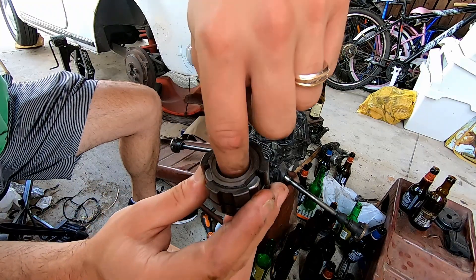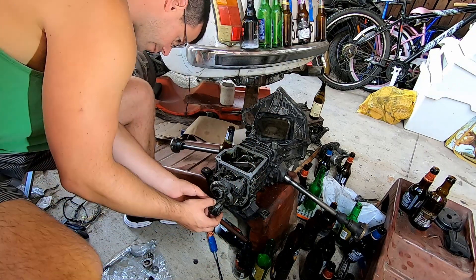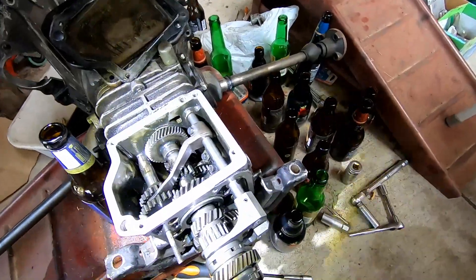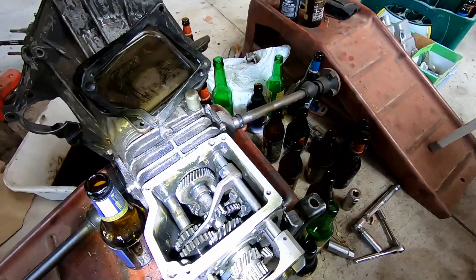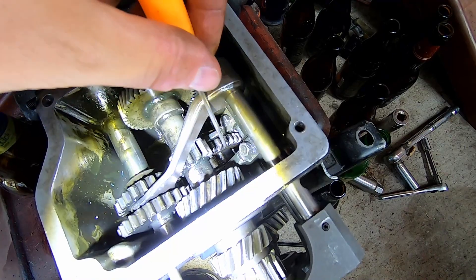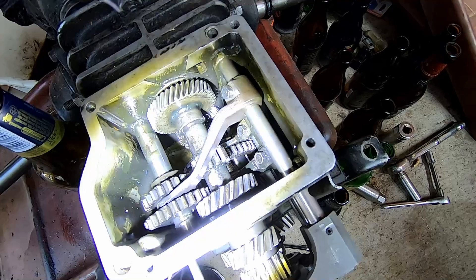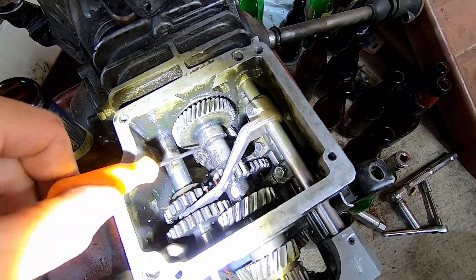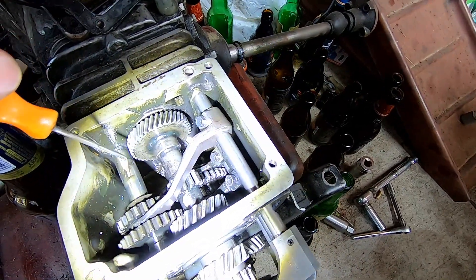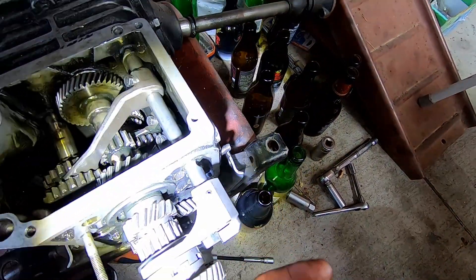Line up that little guide tab with the guide line down here. If you managed to knock this gear off towards the back - it was sitting back here - it's really difficult to get back on. But if you use something like this little tool, get behind it and pry it forward, and kind of pull it up into place while putting some pressure on the lever to pull it out.